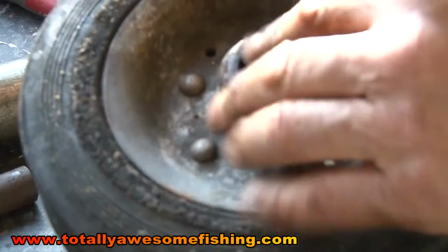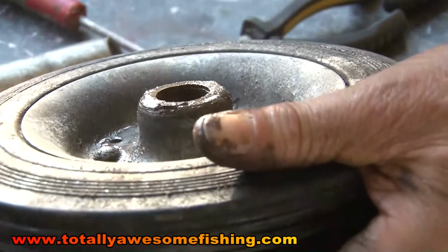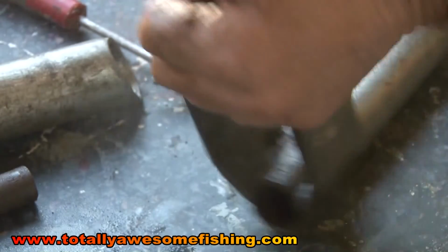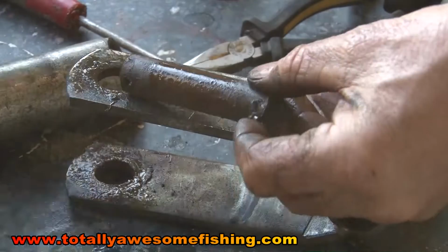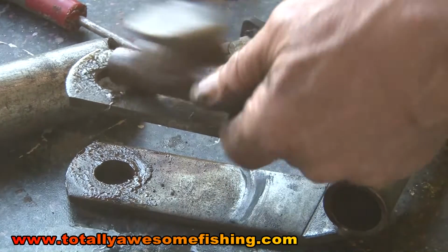And the wheel could probably do with a clean up again. Give it a douche of good old WD-40. Basically it just softens that old grease up, for what it costs. And it helps clean. It makes it a lot easier for cleaning, scrubbing up, and then you can wire brush off and re-grease.